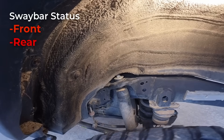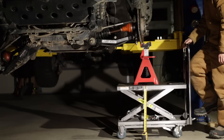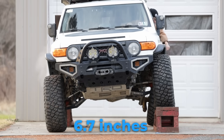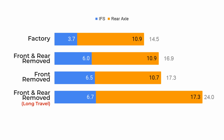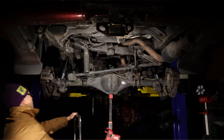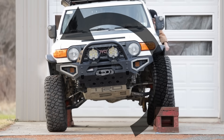In our first test, both front and rear sway bars were removed. Despite my long travel IFS having 13 inches of available travel, it only articulated 6.7 inches — about the same as the factory IFS. This suspension cost me six grand. In contrast, the much cheaper rear suspension was doing most of the work, articulating 17.3 inches. Due to the difference in mechanisms, the IFS behaves stiffer than the solid rear axle in articulation, even if they have similar stiffness in straight up-and-down travel. Because of the front and rear imbalance, my FJ is already leaning heavily to the passenger side, and if we want the IFS to flex more, we really need more weight to the driver side.